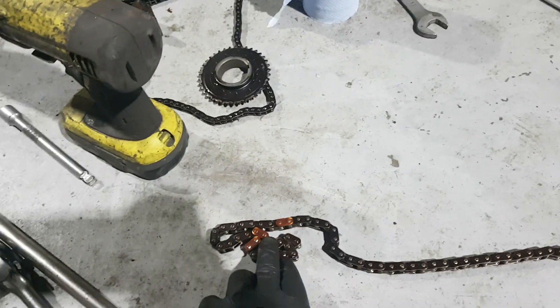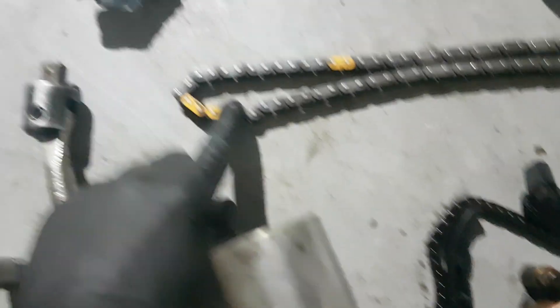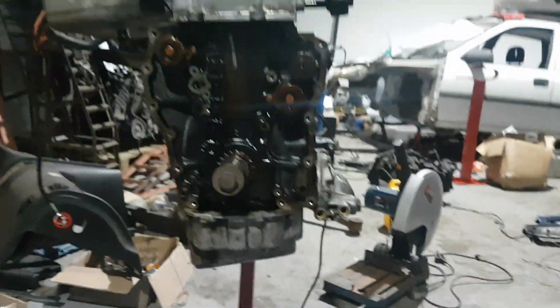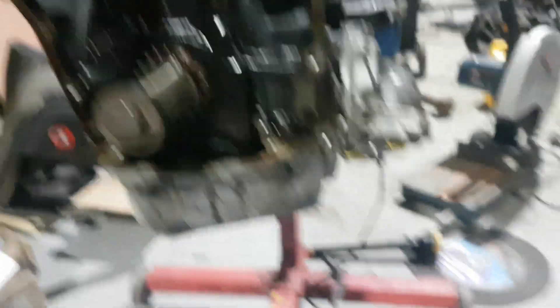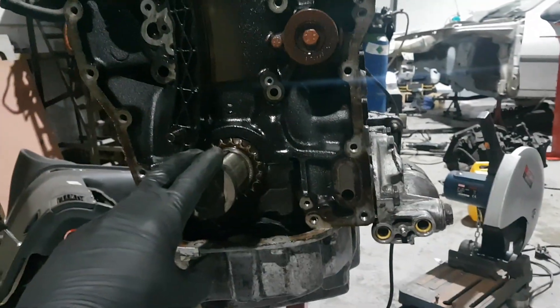So obviously this is the timing chain that came off it, and you can barely make out the chain, so scrap that. I've got a new one here. When you get a new timing chain these yellow marks will be lovely to line up. So basically one cam, two cam, and then crank. The tools you're going to need for this job: 27mm socket or spanner. You've also got Torx bolts all the way around for the timing cover and oil pump housing — they're T40 Torx bits. It can be pretty tight. 27mm on the crank bolt.